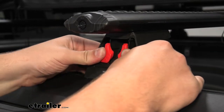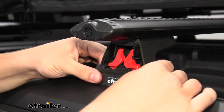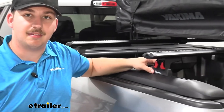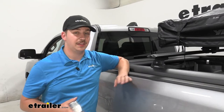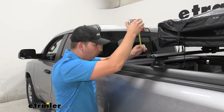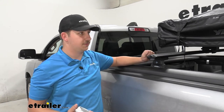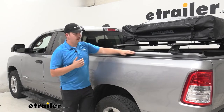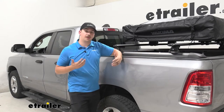I'm not going to fully release this with the tent on top, but if you push those tabs in, that's what allows you to lift the crossbar out of the quick release mounts. So we can quickly get the crossbars off the bases, leave the bases installed, and it's ready for next time. The profile is very low — from the top of the tonneau cover rails to the top of the crossbars, we're sitting at four and three quarters of an inch. The tracks run the entire length of the rails, so we can slide the bases to any point and set whatever crossbar spread we need.